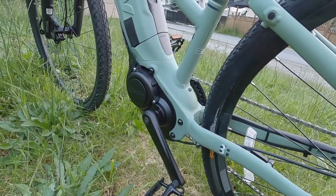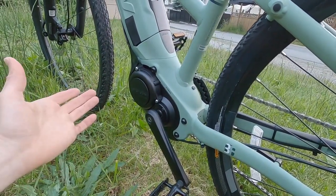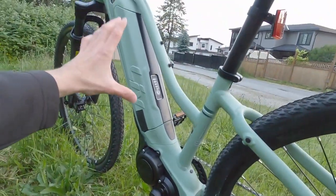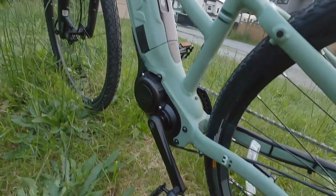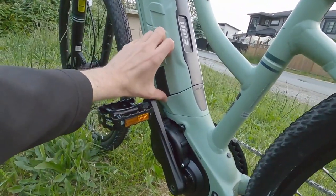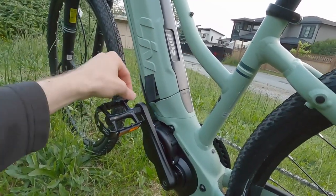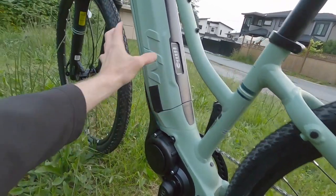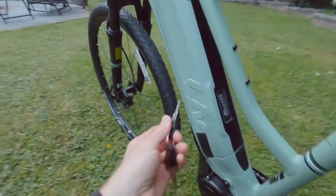You're not going to get the same high-RPM support — if you're in a low gear pedaling over 100 RPM the motor might not keep up, but that's a high-performance consideration, probably not a big deal just cruising around town. This gets up to 20 mph (32 km/h) as a Class 1 product. You're also not drawing down the battery as quickly as with a really high-performance motor. Note that the crank arm and pedals get pretty close to the charge port on the battery pack, so be careful not to snag it while plugged in.